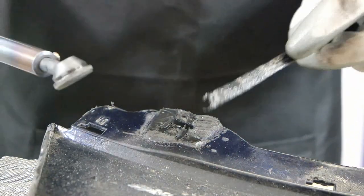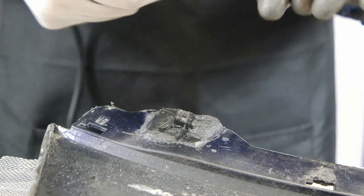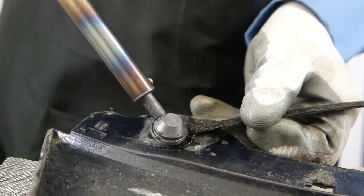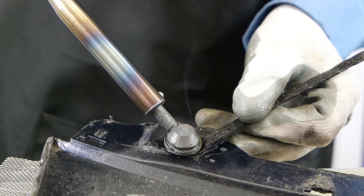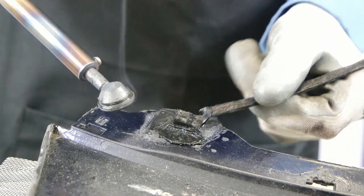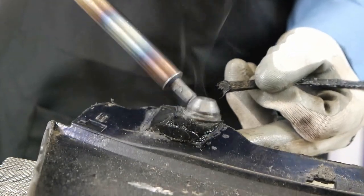The repair itself is to embed the UFLEX or PUR binder first, and after that you will embed the net or fold it. Do it inch by inch. Here is the cut I did before. I will fill it now. What you need to remember is that UFLEX binder itself was to be melted completely, unlike regular welding, and the first layer, the most important one, was to be melted into the plastic that you repair.